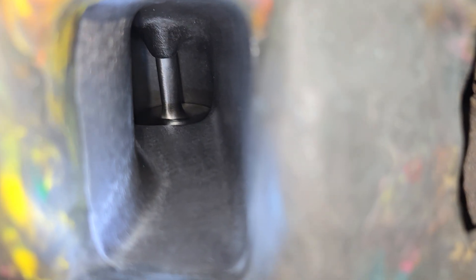This is a 306 fuel injected that I'm pretty sure will hit 7000 without any problems. Some of the things you can notice about this — very fine texture for what I usually do, because it's fuel injected. This is actually a milder texture than the intake manifold has, because I need the really long burr to get in there on the long runner intake. I haven't squirted any Dykem down this one — I want to do the testing on the manifold first.